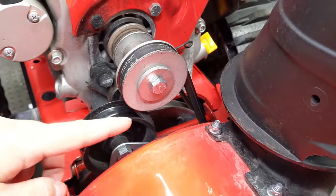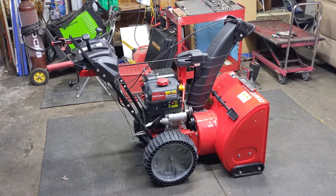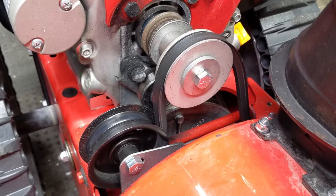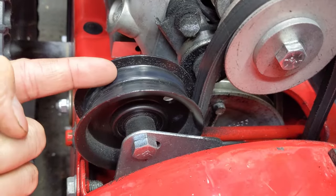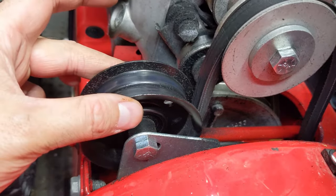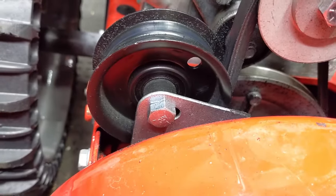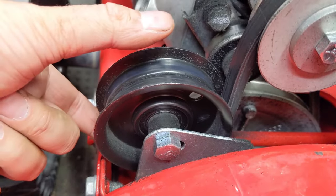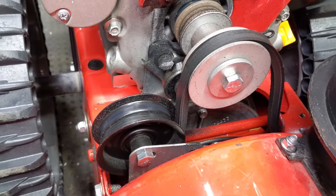When you engage the auger lever, it pulls that cable, pulling the idler arm and idler pulley in, which puts tension on your impeller or auger belt. Using a quick clamp to hold the auger lever down will keep tension on the belt. In this case we do have a fair amount of tension — this is a fairly new machine and this belt looks to be in okay condition. A snowblower without proper auger belt tension will not throw snow as far as it used to. Belts will not stretch as much as people claim, but they do get worn over time. By moving the idler pulley farther in, you can put more tension on the belt. The idler pulley hole is usually slotted, so just loosen the nut and bolt, slide the pulley slightly, then tighten it up. This will limit belt slippage.